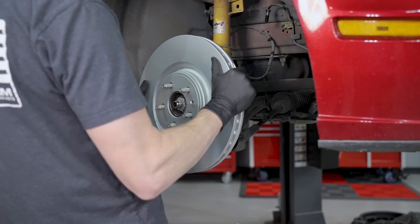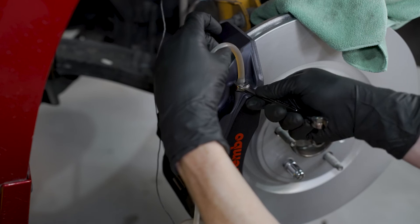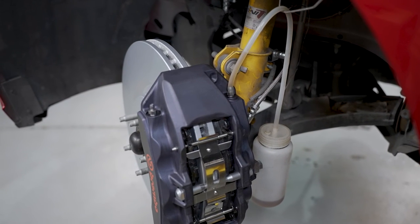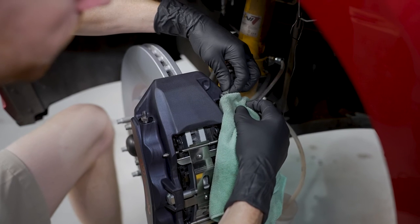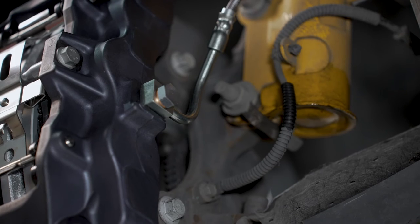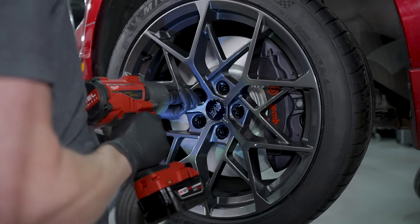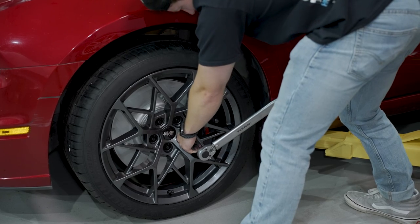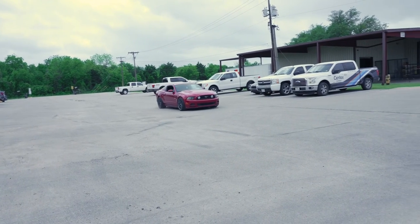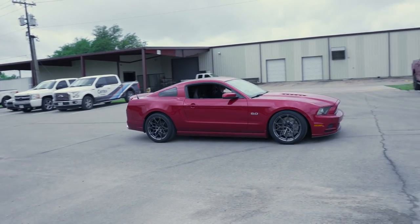Do the same for the other side. Now it's time to bleed the brakes — you'll need some help from a friend. We already have a video covering the brake bleeding procedure for brake calipers with two bleeder screws, and that video will be available in the description. Once you finish bleeding the brakes, check over the hard line to brake hose connection and the banjo bolt to make sure there aren't any leaks. Reinstall the wheels, run down the lug nuts, get the car on the ground, then torque the lug nuts to factory spec. Go for a drive and properly burnish the new pads and rotors — check out the article link in the description for the proper burnishing procedure.